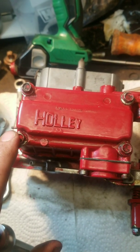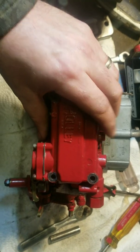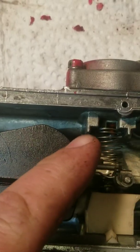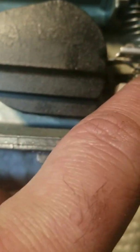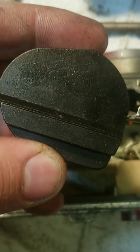So we've got four 8mm bolts to take off and continue the disassembly. Got those four bolts out and this piece should come out all together, which it does. First up, we're going to take this little spring out of here. Once we take that out, we're going to take this little clip off — pop that off there — and this whole float comes out. Just wiggle and it comes out in one piece. Some people test these floats as part of the rebuild, but I'm not going to do that.